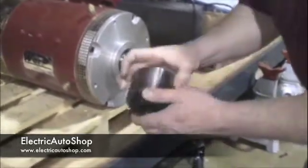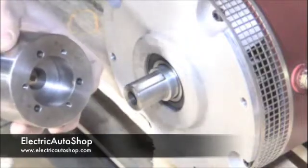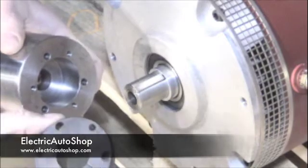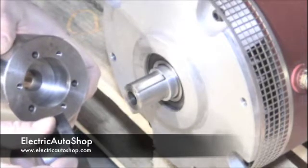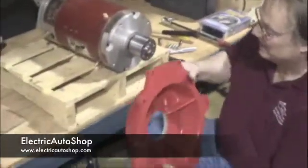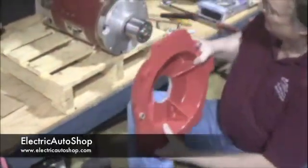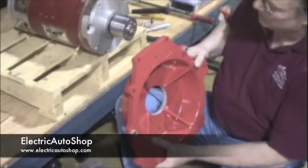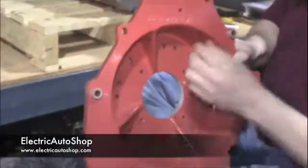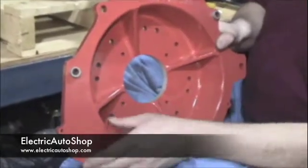What we're going to do is install the drive coupler. The motor coupler assembly consists of a steel machine coupler, and it mates to a taper lock hub. The steel taper lock hub is also fitted with an Allen locking screw as an extra safety precaution. The next step in the assembly sequence is to attach the cast adapter. This adapter will bolt the 9-inch motor on the face to the original S10 transmission on the back. This adapter has been designed to locate everything properly. It has hardened and precise machined dowel pins to match to the transmission, and then the bolt holes will bolt everything together.